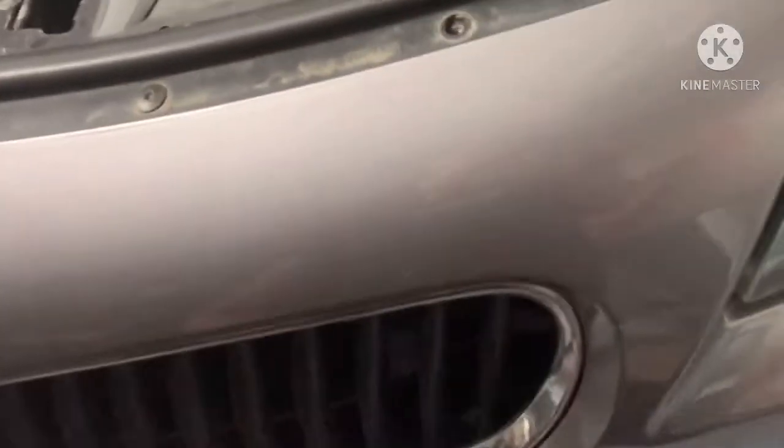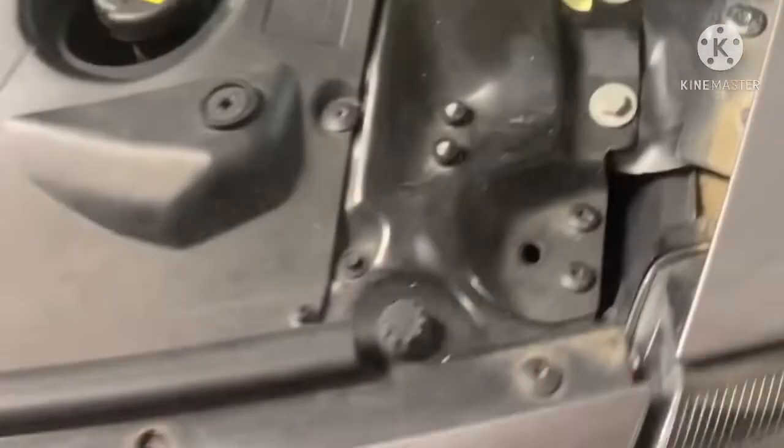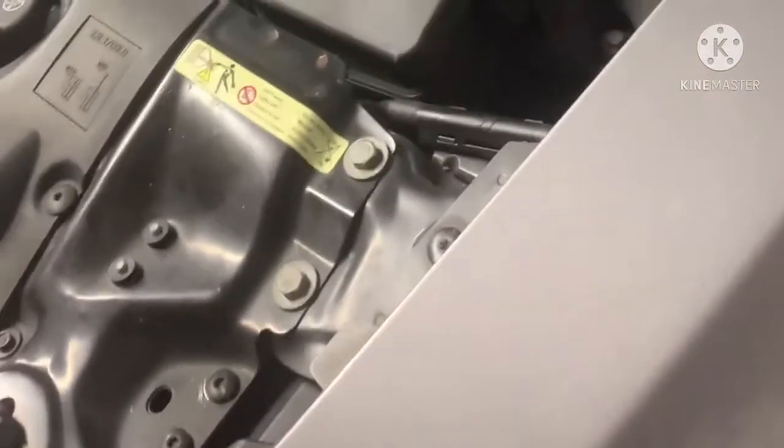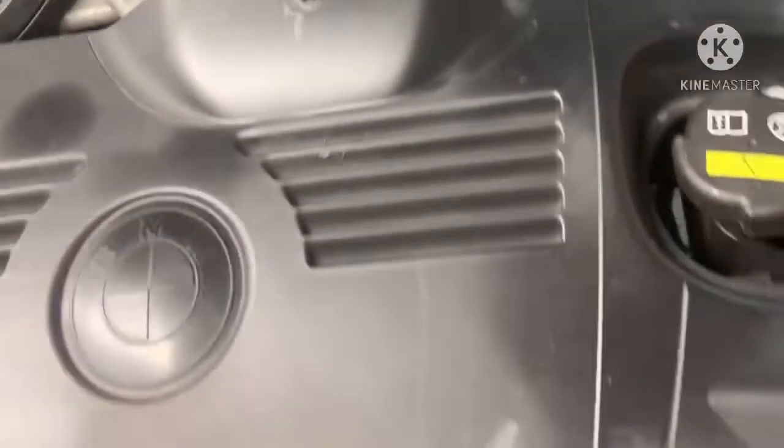Today I want to tell you how we identified a vacuum leak on this 2005 BMW Z4 2.5i, also known as the E85. What happened is I kept getting a check engine light, or a service engine soon light in this case, with codes P0171 and P0174. That means the system is too lean and there's air coming into the system, so it's highly unlikely that both of the oxygen sensors were bad.